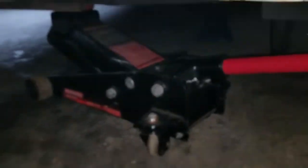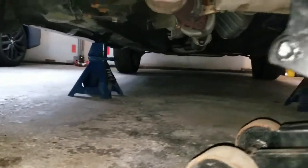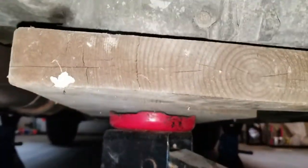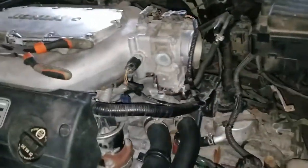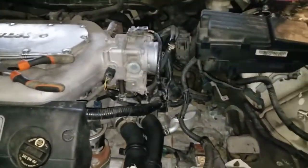I already had that done from my previous video, which I'm continuing. I had already jacked up the car with two jacks, and I also have my jack here with a big piece of wood supporting the tranny — just enough to support it so it doesn't drop when I remove the bracket. I've got a brace just behind the rear tire and my e-brake is on. Safety's number one — safety's paramount. Do whatever's necessary to make sure you don't get hurt, especially if there's someone else around.